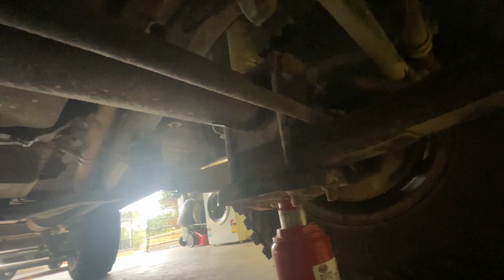And then from there, while holding the spring suspended, I'm jacking the diff up, which then creates a gap in there. Then I can slip it in, drop the diff back down, bolt the U-bolts in, and then let the spring out. And then, yeah. So I think it's a pretty good process. So we'll start on the other side now.